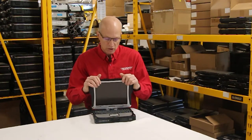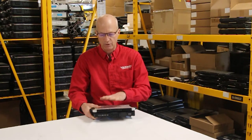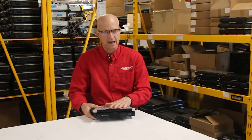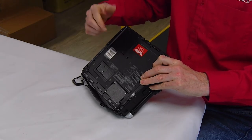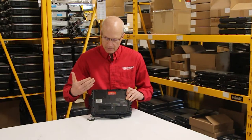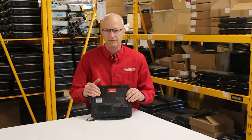And number 1, the most annoying issue on this unit is the webcam upgrade. If you decide to buy it with the webcam, you can't just add a webcam as an upgrade unless it originally came with one, because they put it on the bottom in the memory slot, taking up one of the memory slots. So the max memory you can get on a CF-19 with a webcam is 8GB. I don't know why they did it that way — it makes no sense to me — but that's one of the most annoying and problematic issues with the CF-19.